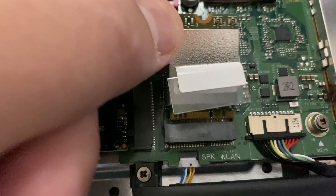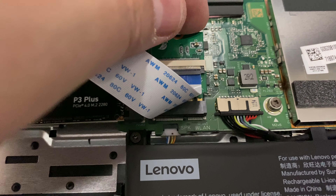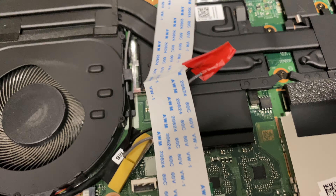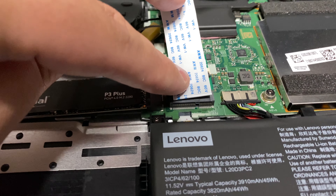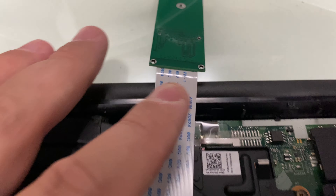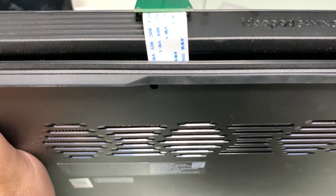This is an AE key Wi-Fi card, but interestingly the port might be a standard NVMe port — there's no extra notch, which is interesting. This is what the slot looks like without devices — only the shorter 2242 board would fit here. Now let me put the screw in. I'll probably want to bend the cable to the other side and have it come out the back as an external port. The cable looks bendable and it should be able to come out there without jamming the cover.